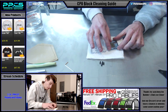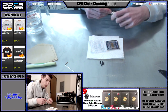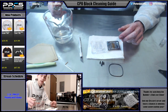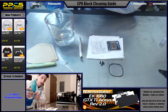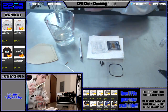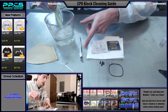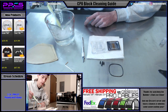I'm going to take out the O-ring. One useful tool for cleaning a block is an exacto knife, or even tweezers work well. We're going to want to wipe that down. To clean it, I'm just going to use some distilled water with a little drop of dish soap — that should be plenty. A toothbrush actually works pretty well. If you have a new toothbrush sitting around, just use that. Otherwise, an exacto knife blade for cleaning the fins is also pretty useful, or any razor blade like that.